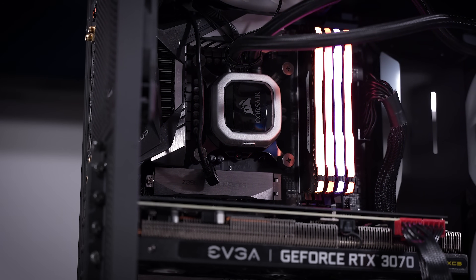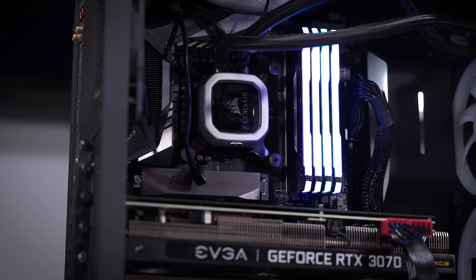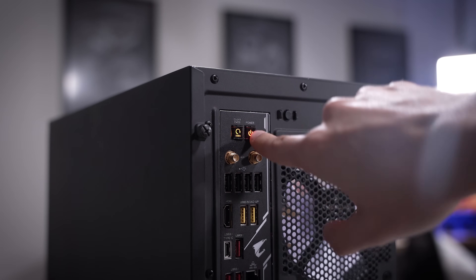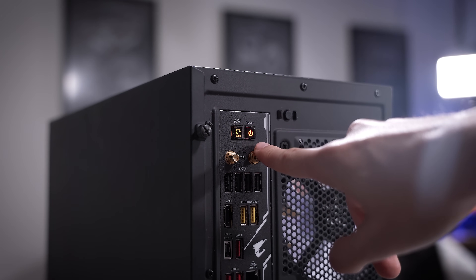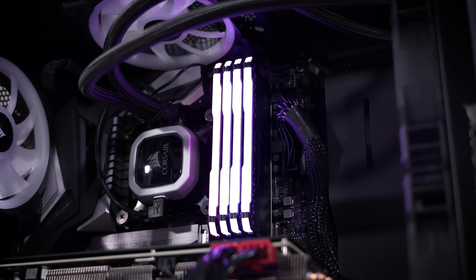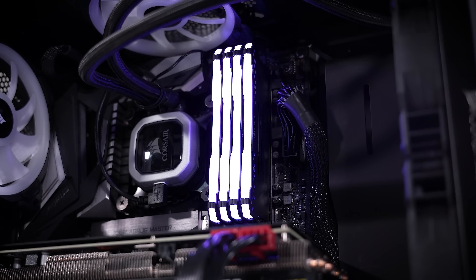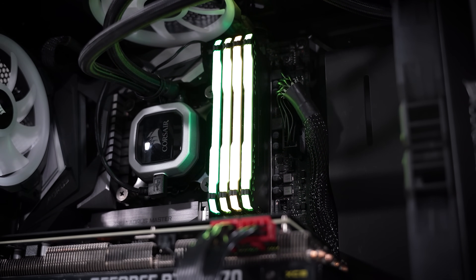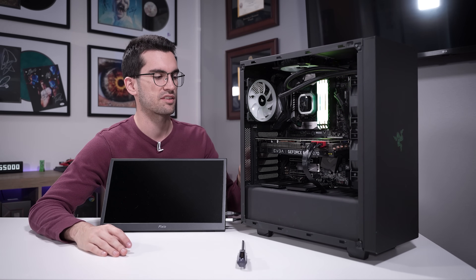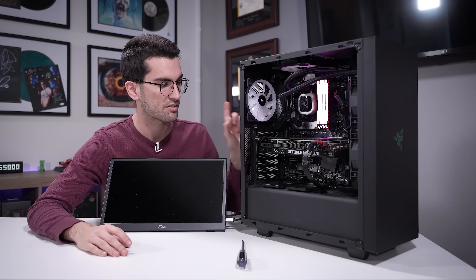The next thing I'm going to do is remove the graphics card and try powering it on then. The graphics card is very easy to remove, which is one reason I'm tackling it this early. I've already cleared the CMOS and checked that the RAM is seated correctly. If removing the card doesn't fix the issue, we'll replace the DIMMs with a known working one from my stash. If that still doesn't work, we'll have to test the power supply — though I don't expect it's the culprit, since we are getting some power. Let's get to that graphics card.